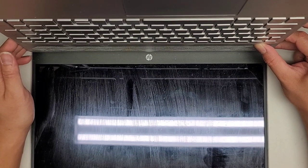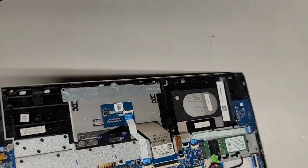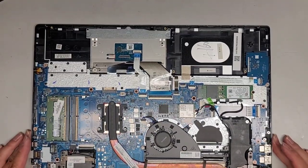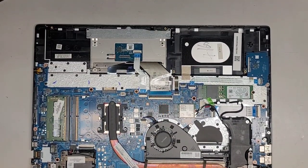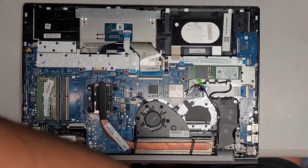We're going to press and hold the power button here for at least 15 seconds to drain any residual power — this makes it a lot safer to work on. If you're going to be messing with the LCD LVDS connector, it's actually very important — you don't want to skip this step. It only takes 15 seconds. If you don't do it, there's a very high risk. Anyways, if this video helps you out, make sure to like, subscribe, and share my channel with others so they can learn how to upgrade and repair their devices.